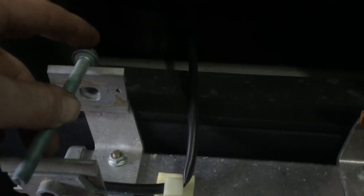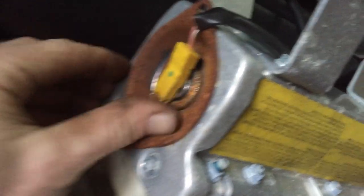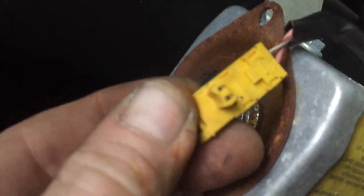You see where the two bolts were? That long bolt was right here — I had to unscrew from the bottom right here and it came out connected to this piece of the frame right here. Then there's one little plug right here. You take your screwdriver and just pop this off like that. Try not to break this — it's really easy to come out. Undo the latch right here and that's it. There's your airbag, and then you just do it in reverse on the way out.